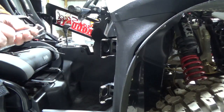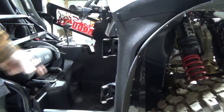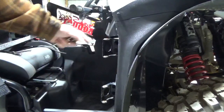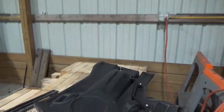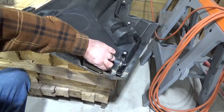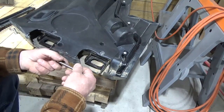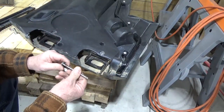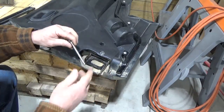Over here I've got a stock door. Here's your stock door — and notice there are no bushings in there. That's where a lot of guys are having problems, because this pin will turn inside there and wear it out. So this will eliminate it — the pin will turn with the door, so you're not having any friction on the hinge. It's all going to be on that bronze bushing.